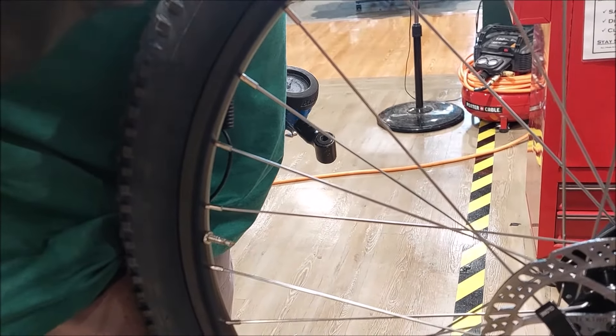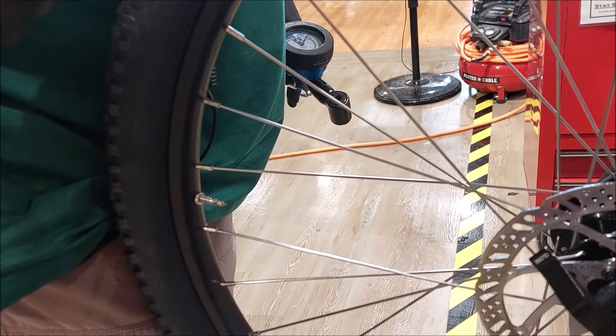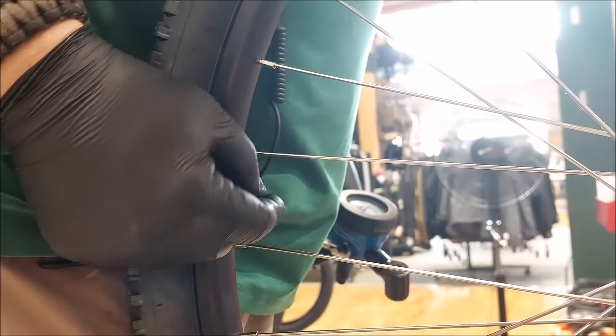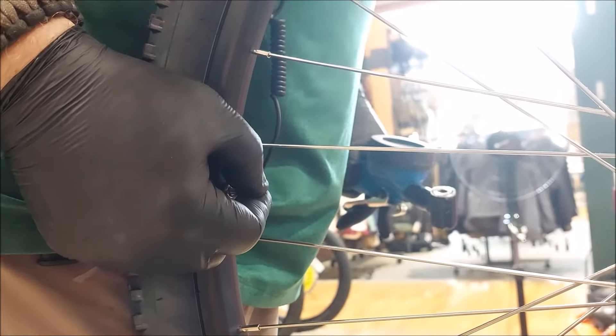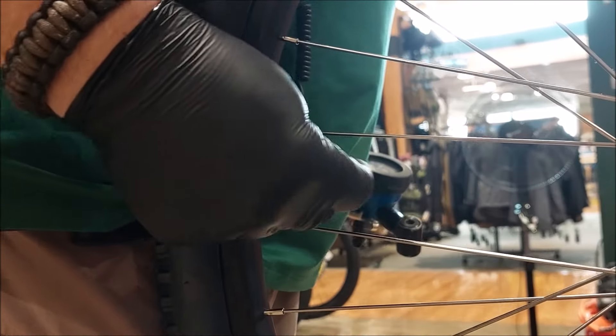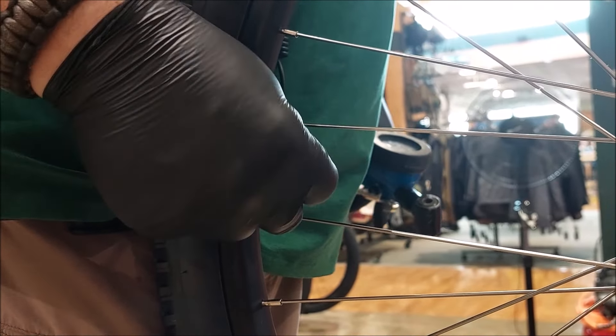The micro movements will actually cause the base of the valve — which is nothing more than rubber cemented onto the tube — to start giving way over time. Also, if the valve head isn't sealed properly it'll leak micro amounts while spinning, and you'll be trying to figure out why you can't keep air in your tires. Finding a micro-leak is like finding a short in electronics.